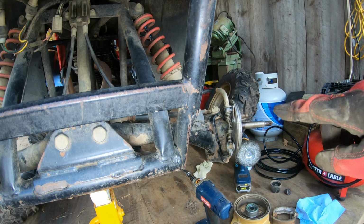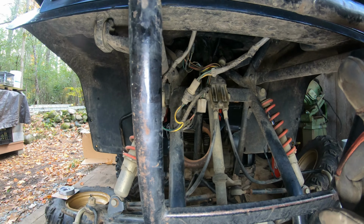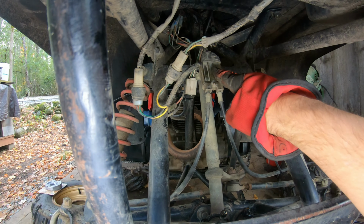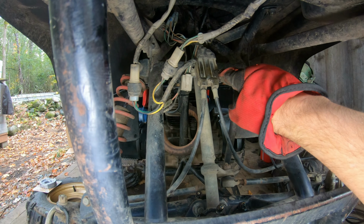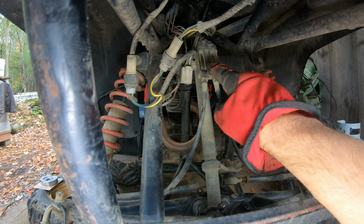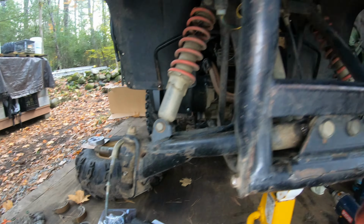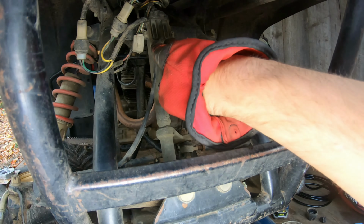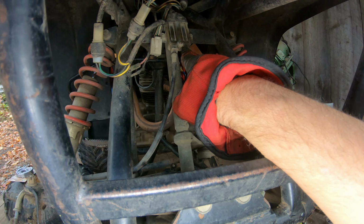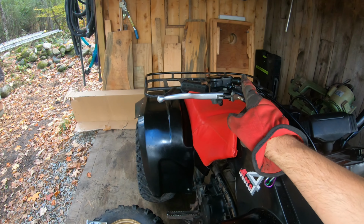Once we have the brakes on and the wheels on, we start adjusting for tuning. When we pull the brakes up top, we're watching for this to pull level. If it pulls off at an angle, like for example, if the right hand side was lower, left hand side was higher, we're going to want to tighten this cable up by tightening down here and loosen the right one up by loosening this down here so that we get these pulling even. Once we have them pulling even, we'll take up any leftover slack up here at the handlebar.